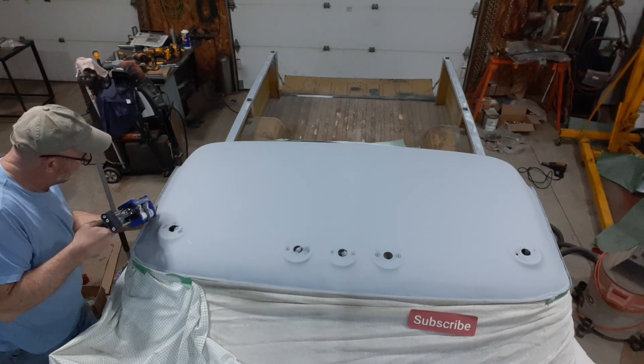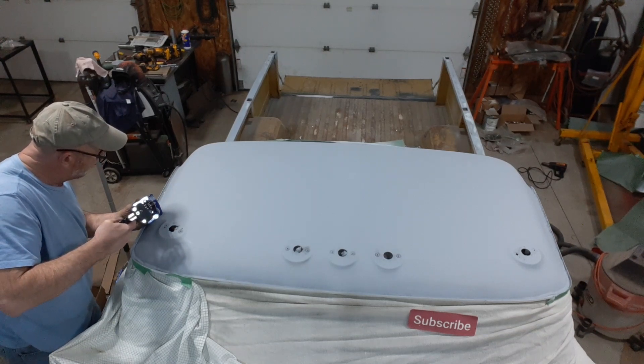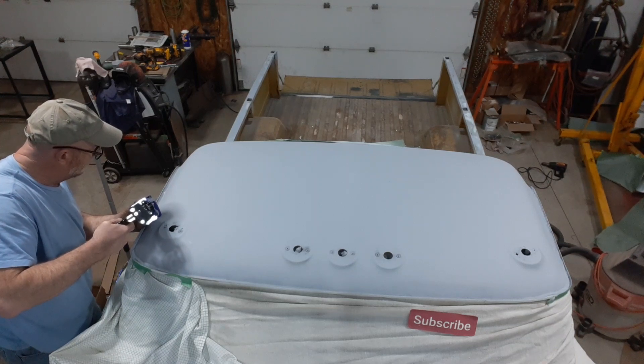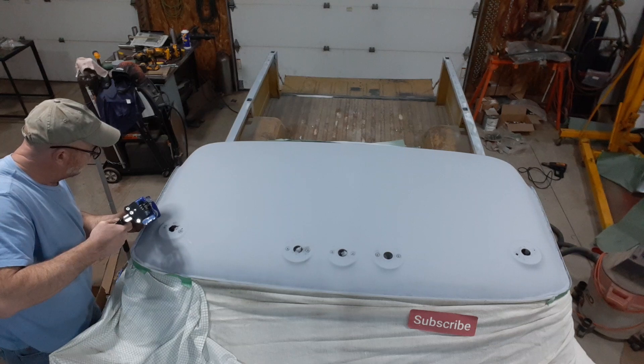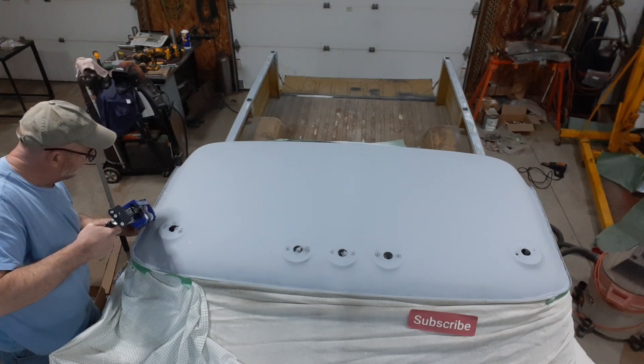I'm always nervous doing this. Like I said, you get one shot, and I think a tube of this stuff is like $40 so you kind of hate to even think about ripping it back out. I aim it towards the outside of the rail because the rail is tipped in a little bit, so it will tend to flood in towards the roof panel — you don't have to be so concerned with getting enough on the outside. It's going to settle right into every little nook and cranny and low spot there is. If you have any holes, it will run down into them — if you've got one over your dash panel, it will leak right down in there and lay on the dash. Ask me how I know.